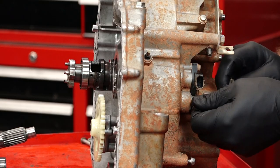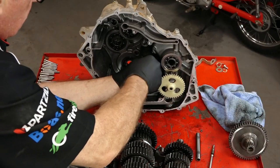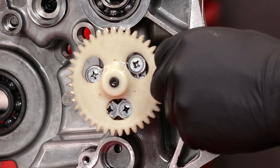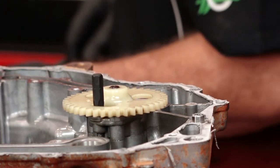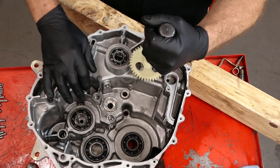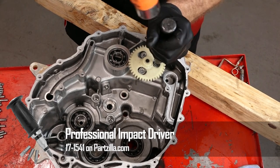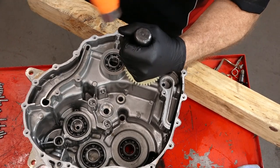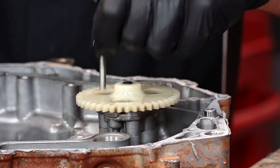Get the shift detent released and the spring out, get that circlip off, then we'll be able to remove the shift drum. Get that little plastic gear removed from the housing. We're going to use the impact on this — pick out the right bit. When you're doing this, make sure it doesn't rock around, otherwise we'd strip it. Whoever put it together did not use any Loctite, but I probably will — not the red, just blue would be fine.